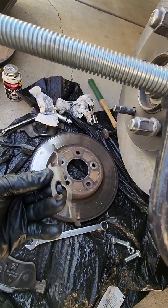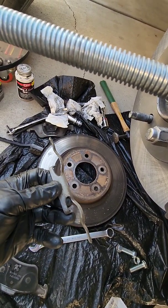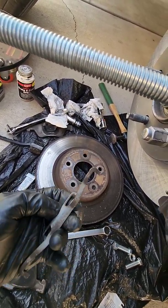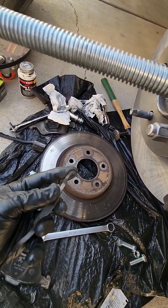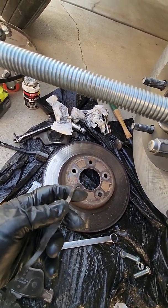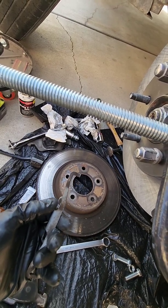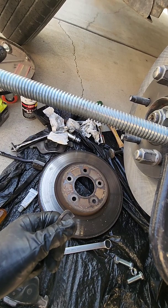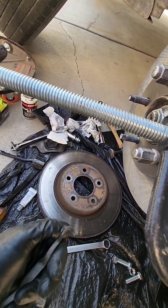so basically I got this end and this end where they belong, and then I got this one into the hole, and then this end was on top of where it was supposed to go instead of, well, it was supposed to be below, but I had it on top of the caliper bracket. I took the C-clamp in this area and held it in place so these parts wouldn't pop out. I took the screwdriver, forced this thing out around the bracket, and then it snapped back underneath.